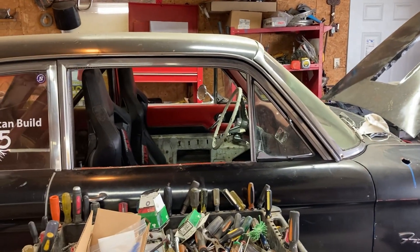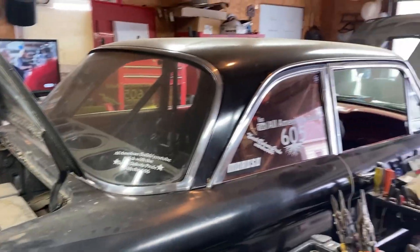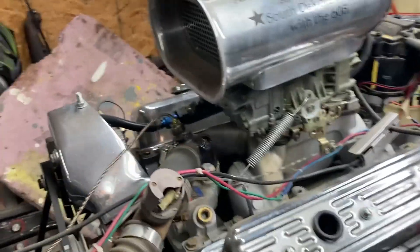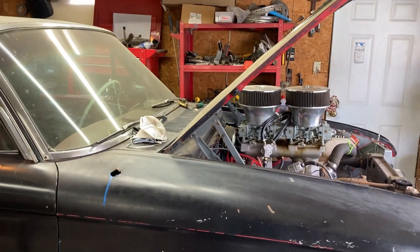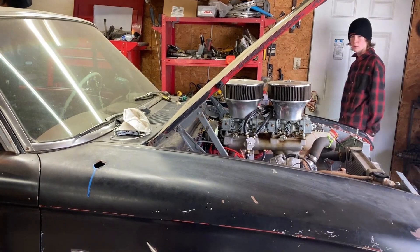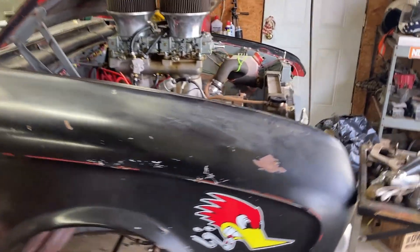It came out of this car brand spanking new — the pistons are brand new in it, it's really nice. Can't wait to get this one out soon. That's a 358 balanced blueprinted badass motor there. We're getting another one built too right now — Uncle Terry builds all our motors. This one's 60 over, 350, two-bolt main. The heads are in right now — we're getting 7/16 stud kit put in it and the tops are getting ground down for the big cam we got in it. It's going to be interesting.